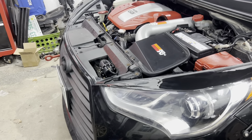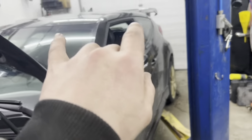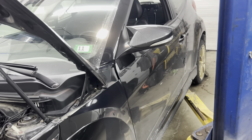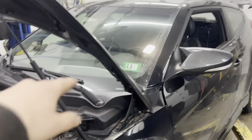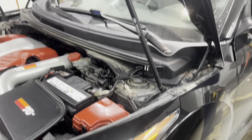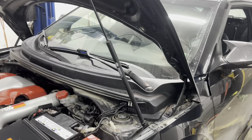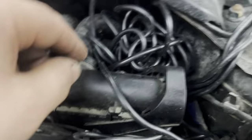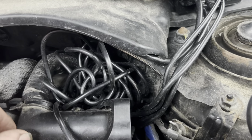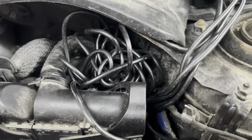Which is back-feeding electricity somehow, then causing all of the underglow to glow different colors. I had those two lights warrantied out. We're just gonna slap the new one on the front. The rear one, we're gonna cut the rear harness and just solder it in, because the extension is run underneath or through the subframe, which is gonna be a real pain in the ass to drag back out. And also, I'm going to neaten up this clusterfuck of wires because I did that in a hurry.